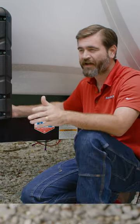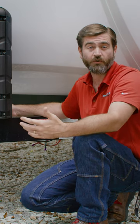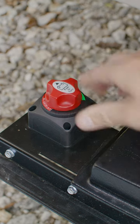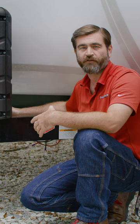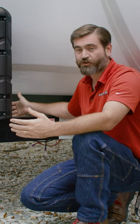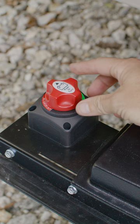It's pretty simple and does exactly what it sounds like. When you go to put your RV into storage, all you have to do is flip this little switch and it disconnects the battery from the RV. In other words, if you left any lights on, they can't drain your battery down while it's sitting in storage.